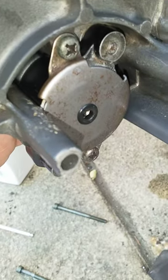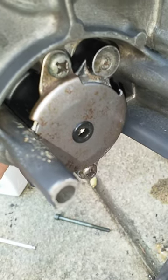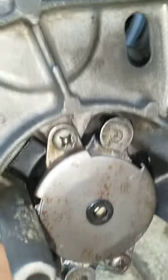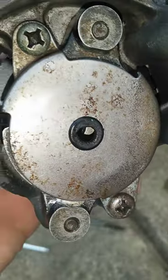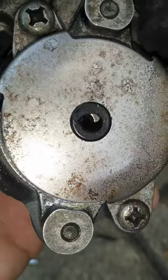Hi, this is the second part to the Suzuki RF900 clutch slave refurb kit. I put the main part in there and this is the bit which I have replaced the cylinder seals. What I have also done is put a grommet in to prevent any further muck getting in.